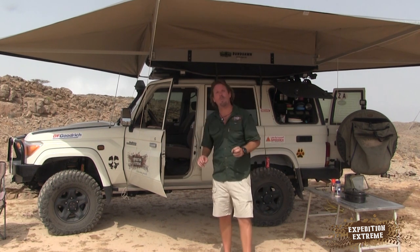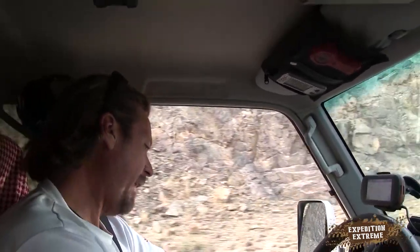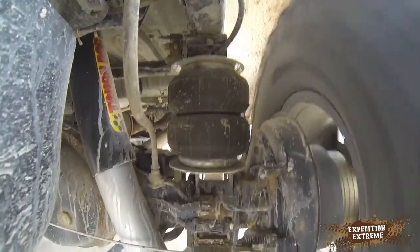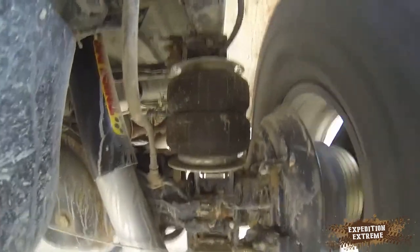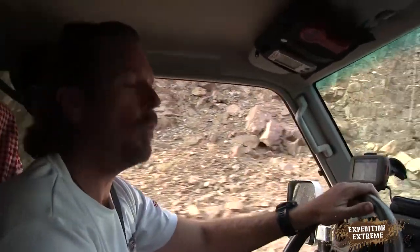On road it gives you phenomenal performance. What does it do off-road? Off-road, you deflate the tires and adjust the suspension. I can play with deflation — don't go below 10 PSI because then the bags lose integrity and it'll pinch. But I can set the ride to really become like a boat. On corrugated sections I can speed up to 80 km/h, then inflate slightly for a stiffer ride to be confident through corners. As soon as I have to slow down, I deflate it all the way again to get through rocky sections with full articulation, because when the bags are soft the suspension can move without their interference.